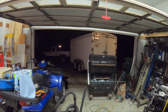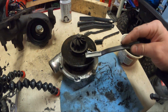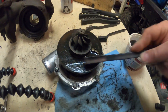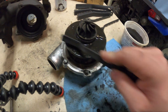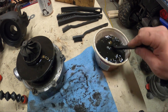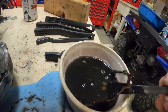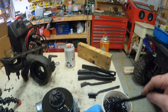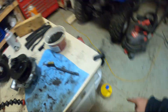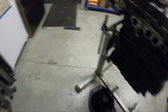Trailer's in place. I put some of the parts in that degreaser — splashed around a little, put some up here — seems to be working. A lot of this caked-on stuff I don't think we'd get without an actual abrasive, but I haven't even scrubbed on it and it's already getting clean spots — it was completely black. I think this stuff is going to work really well. Plan is I'll grab one of my spray bottles and start spraying the engine from the top down with hand brushes and something underneath to catch the dripping.